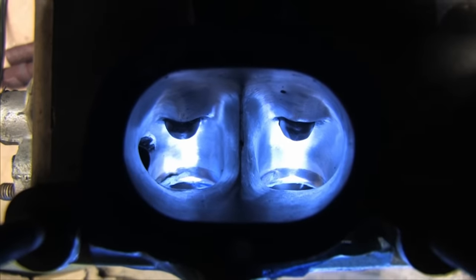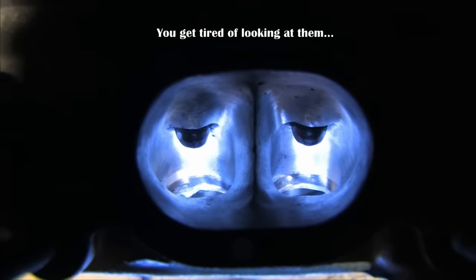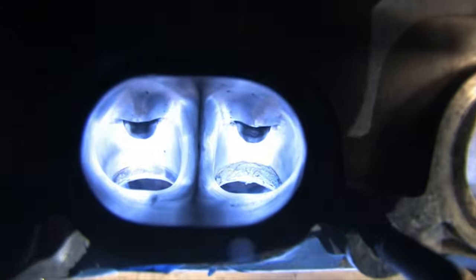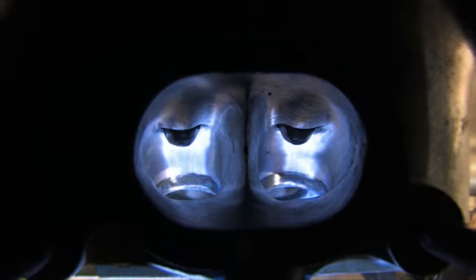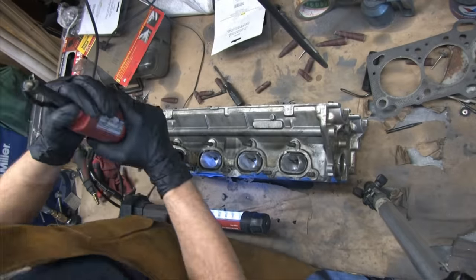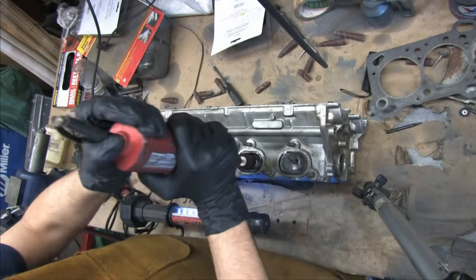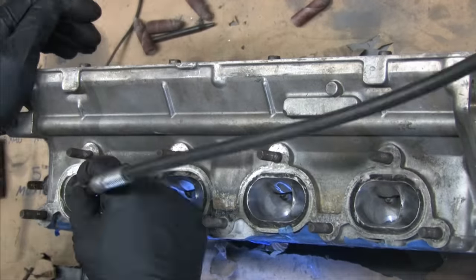Here's what the exhaust ports look like after the 120 grit is complete. The knife edge is defined and the runners all match. All of my transitions are blended and there's no rough cast left. Just a few divots and holes uncovered because this head is cast apparently from Swiss cheese aluminum. Nothing I can or will do about that except demonstrate how it will be in the final finish. Once you're happy, move on to the buffs.